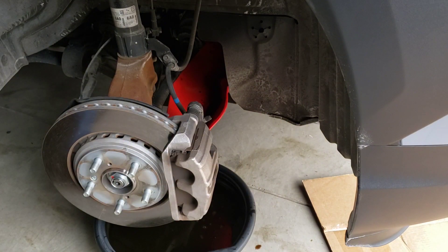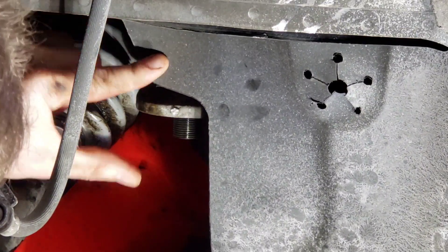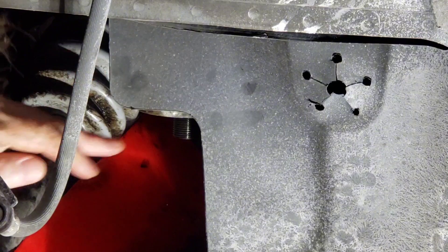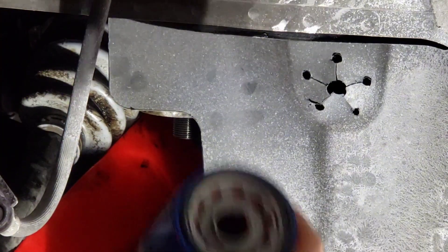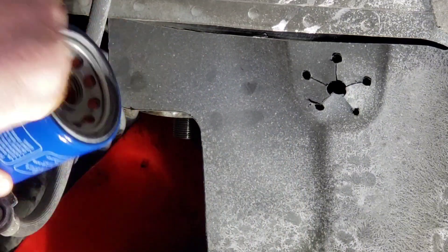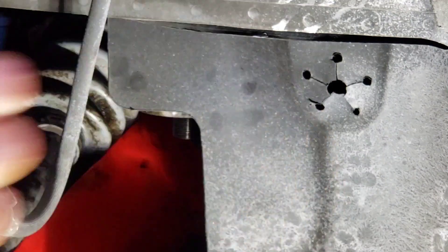While that's dripping, I'll go ahead and get the new filter ready. I've got some light on there so you can see back here - there are threads. I'll wipe this housing off. What I'll do is put a little oil on this seal and then pour the filter as full as I can get it, let it seep in, and then screw it on. I'm going to use the sixth can of oil - the one I'll use to top off - so when I put the five quarts in I know they're complete full quarts.